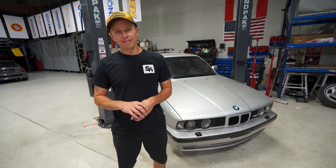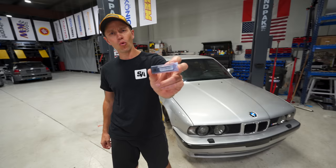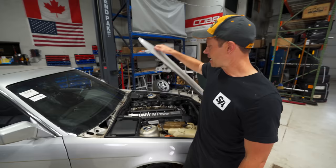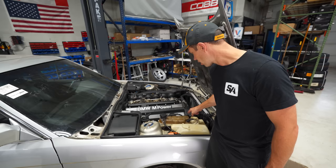Welcome back to episode two of the BMW M5 refresh, where we finish this thing up and add a little bit of old school performance. If you guys are just tuning in, in the previous episode we took care of the intake system. We did a full refresh on all the hoses and vacuum lines, a valve shim job, and we took care of that tensioner which was leaking and bad — now everything is good mechanically.